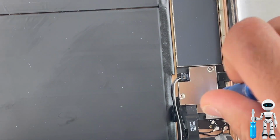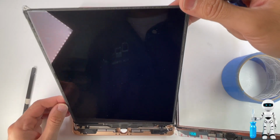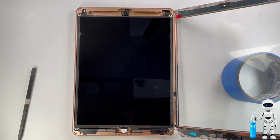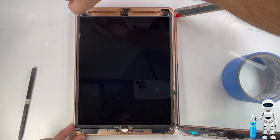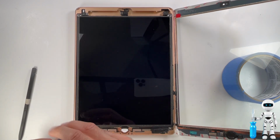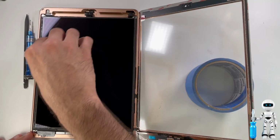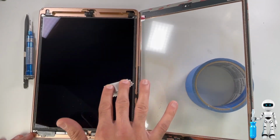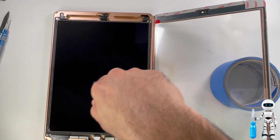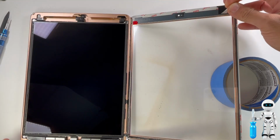Once the shield has been screwed down, we're going to install the LCD. Remember, keep your fingers off the display. I like to go around the frame of the LCD and push it in so it sits in there nice and snug. Grab your Phillips screwdriver and your 4 screws and tighten all the screws back in slowly, that way you don't slip and crack the LCD. Let's go ahead and do some last minute cleaning with a microfiber cloth and a little bit of air to clean off all the dust and any remaining fingerprints that might have been left behind.